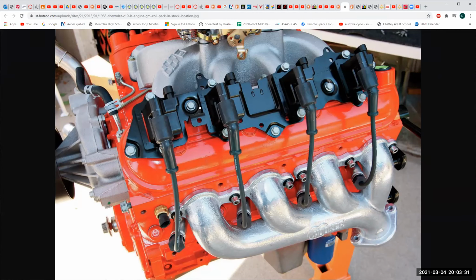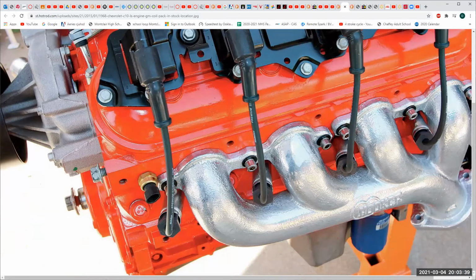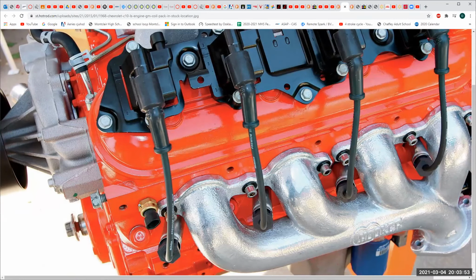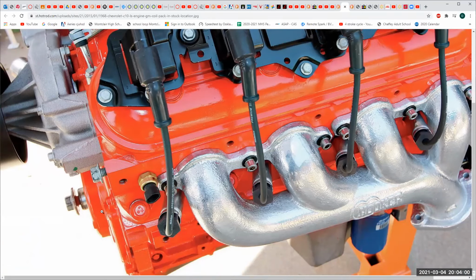Now my question to you is, what does it mean when a bolt has a number on the top? 8.8. This one says 10.9. What type of bolt is that? That's the strength of the bolt. That's a metric, right? That's how metric bolts show you the strength of the bolt, right? Chuck's absolutely correct. If they were SAE fraction of an inch, they would have lines on the top to tell you how strong they are. But these are metric, so they say 8.8, 10.9, whatever.